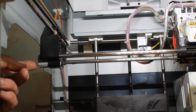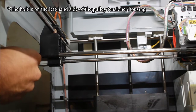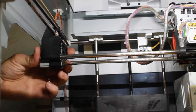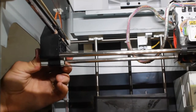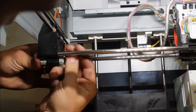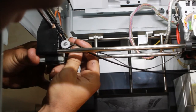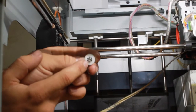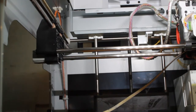Alright, let's get into it. What you want to do is undo this — from memory there's a bolt. My bolt is actually missing because I sanded this 3D printed part down to be very tight and noticed I didn't need the bolt, but it's always best to have the bolt. So you want to push this x-axis pulley as far as you can inwards, and then grab the belt and kind of pull it out. On your original part, you'll see the little bearings won't be there, so let me go ahead and take them off without losing them — I've lost these in the past.